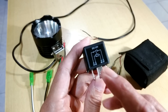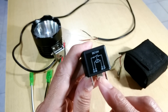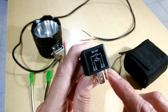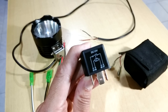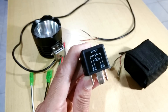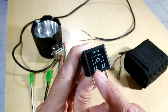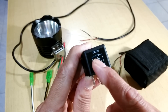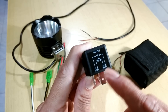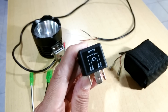You can see here there are four pins. Pins 85 and 86 are the electromagnet. Pin 30 and 87 is the second circuit, which you use to feed power to the device that you want to use. So if you put power to 85, it comes out from 86 to negative, then the magnet will pull the connector down and complete the second circuit, giving power from pin 30 to 87 to the device.